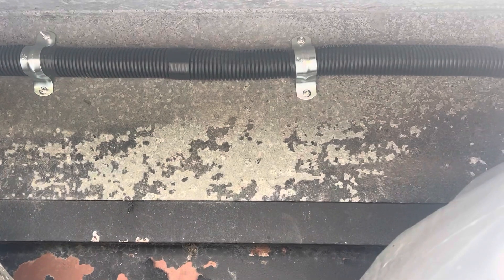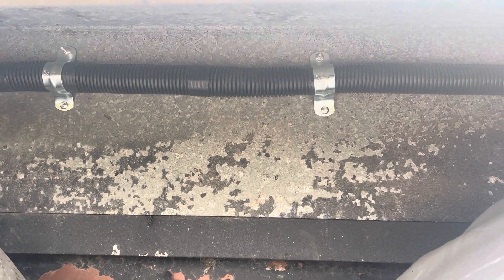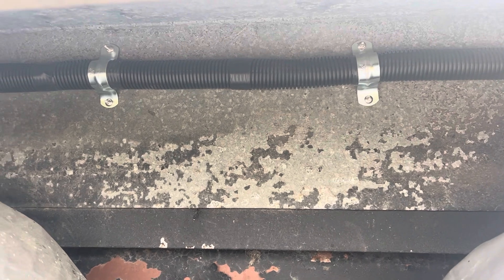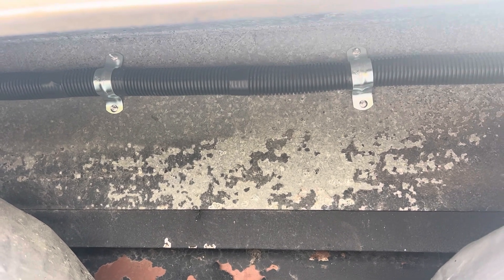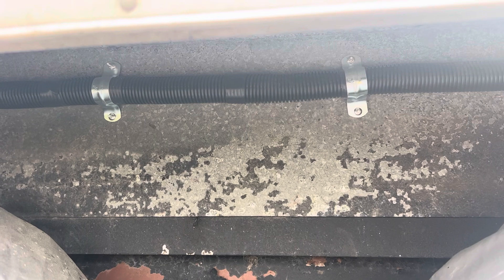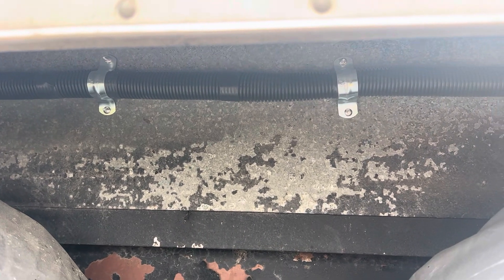When I got to the wheel well, I did something very similar, only instead of zip ties I used metal clips, and I used Olympic rivets — you can see they stick out a little bit, they're not like regular rivets. Each one of these rivets will hold 225 pounds on its own, so each one of these brackets has 450 pounds of hold on them. I took both tires off to route the loom around and it goes back in down here.